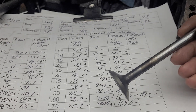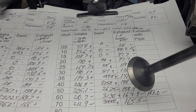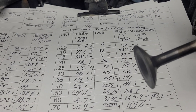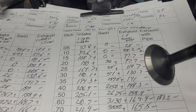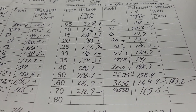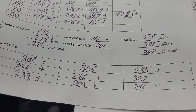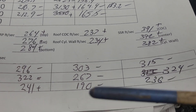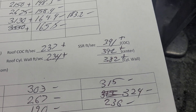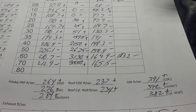This is the tulip up close — it looks like it's just got a regular straight 45 across it. I don't believe I would use a back cut on a tulip; I really don't like back cuts on the exhaust anyway. That valve shape seems to work a little bit better. Now let's take a look at what it did with our airspeeds — that's where we were, these pluses and minuses are in reference to that: minus, plus, minus, minus, minus, minus, minus, minus. Ouch. It's surprising it's as good as it is because the airspeeds really say it takes a beating.